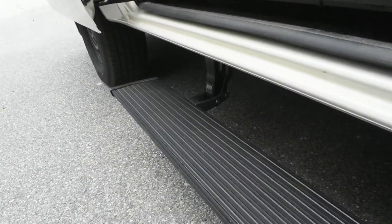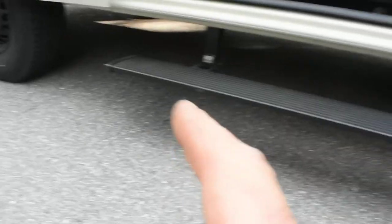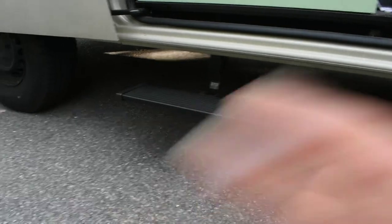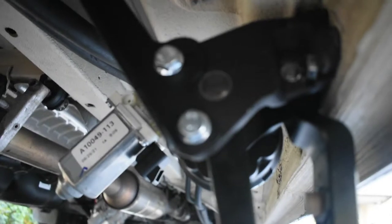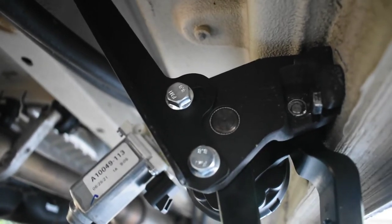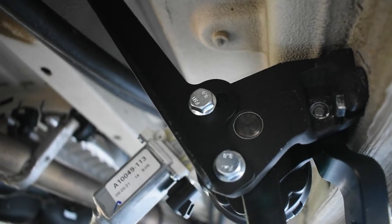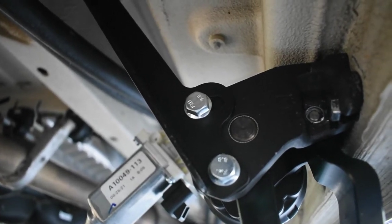The next step is to install the running board onto the brackets. I checked my dimension from the rear to the mounting brackets — nine inches — and then I cinched down all the bolts. I had to modify this bracket just a little bit. See, that top hole is slotted, and I had to extend the slot to the left just a little bit closer to the flange edge. Not a big deal, but it'd be better if it didn't need to be opened up.